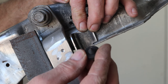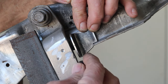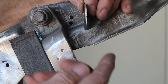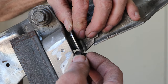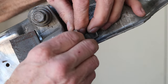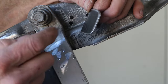Off camera I built this - it's just a piece of angle iron that goes about like that, and you can see the gap there for this rubber bumper. You just drill a hole and poke it through. Originally I thought I'd just drill a hole and have the pedal hit it, but eventually it would probably crush that because it's a smaller area. So I'll get a little plate and weld it on here so we have a big flat surface that it hits every time. I just need to move that inboard a little bit. I have to drill a hole for the rubber bumper to pop through, and then we can get to figuring out the geometry for the new clutch master cylinder.